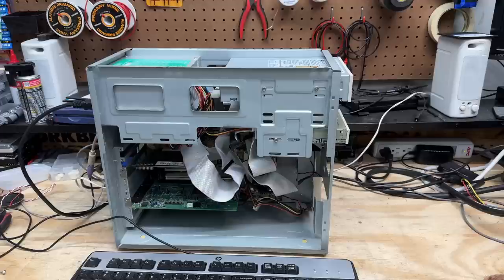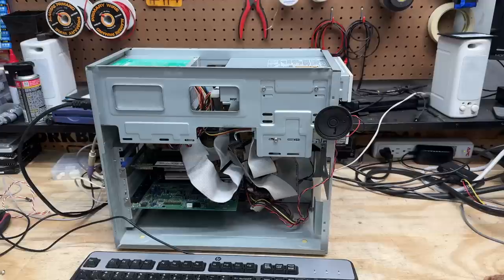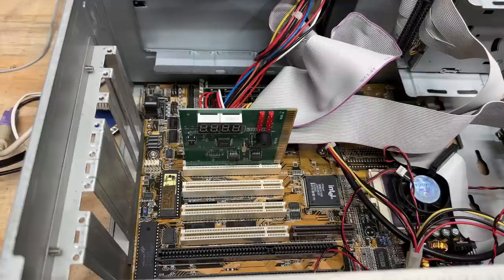Let's see if we're nimble enough to boot with a dead RTC — because it's most likely dead. Power on. And that thing's not even posting. I'm going to reconnect the speaker and see if it's beeping about anything. Nope, quiet as can be. Let's try pulling the video card and see if it complains about that. Nope, this thing has issues. Let's see what the post analyzer card says.